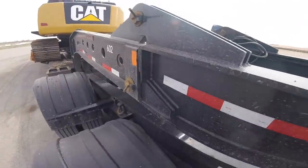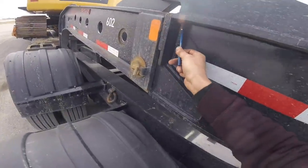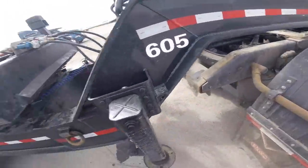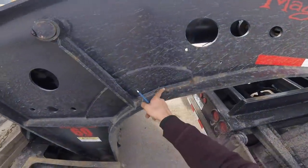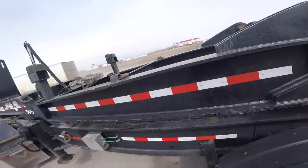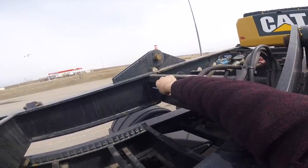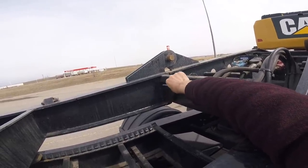This is the neck that was built by JC Trailer. There's a weld — see this weld? But on the opposite side — and that's where that rusty water was coming from. It's hard to see, but it's in the corner at the very top with like this bar. And at the bottom I see there's rusty... and it's a crack.